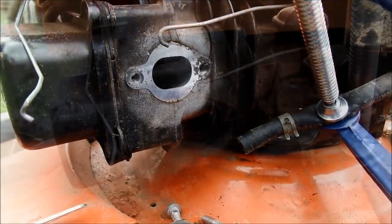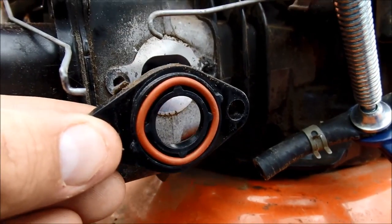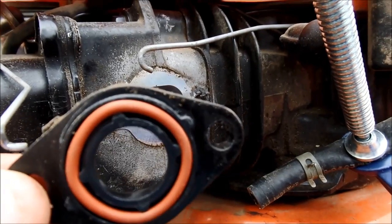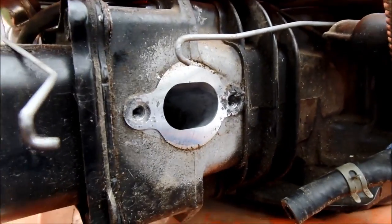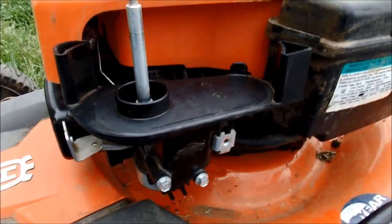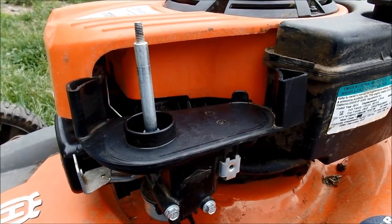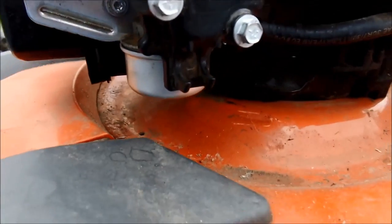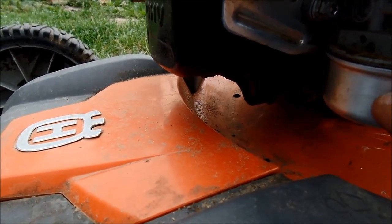Okay, I took off the little plastic piece that rides on it, kind of Honda-esque, if you ask me. So all we're going to do is peel off the gasket, the little remaining pieces over there. We also got to clean it off the back of this. All right. So about the only thing I really did differently was basically replacing the gasket for the bottom fuel bowl.